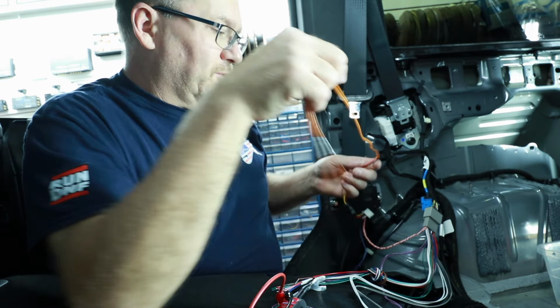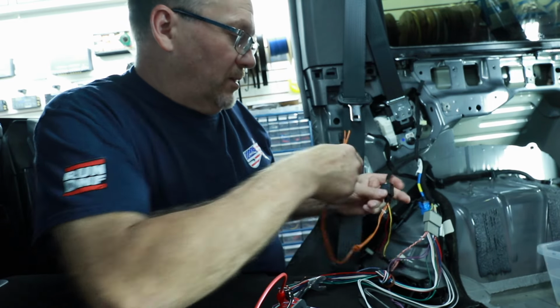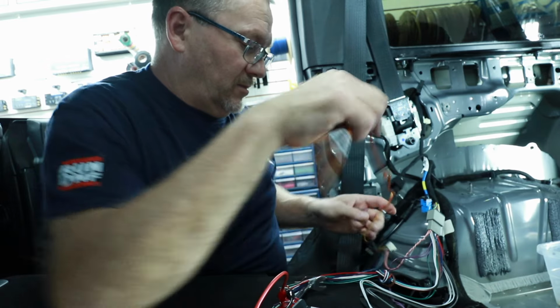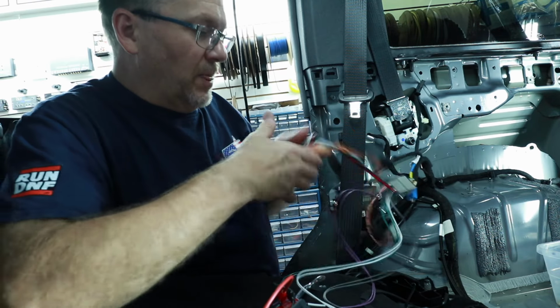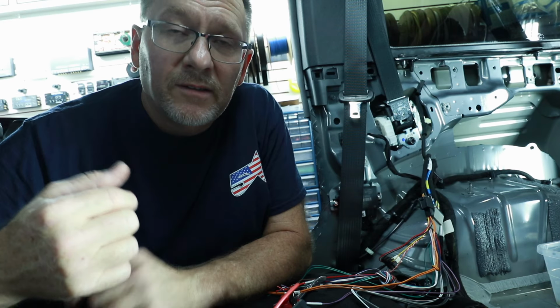On the power harness over here, there's an orange set that isn't connected to anything either. And there's no wiring on the other side of it in the harness. So I've just tied all those together, which I can now strip the harness of all of these nightmarish wires. This also validates that unfortunately the rears, as this says, are behind the radio.